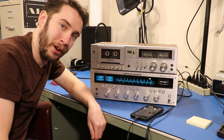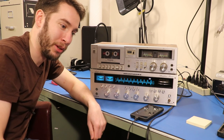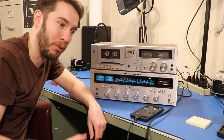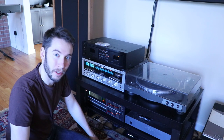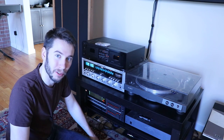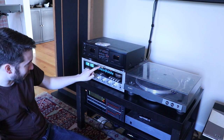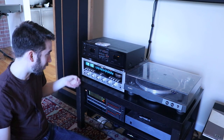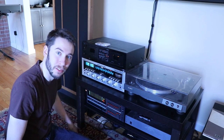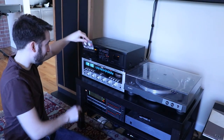But what if you want to do it the hard way? What if you want to make a truly authentic 1980s mixtape with vinyl records and pull one tune off of each record? Let's say we want to do hard mode — we're gonna set our receiver to phono with our record player plugged in, then hit the tape source button so we can hear what the tape deck is hearing. Let's take our cassette tape, cue it up, and put it in.